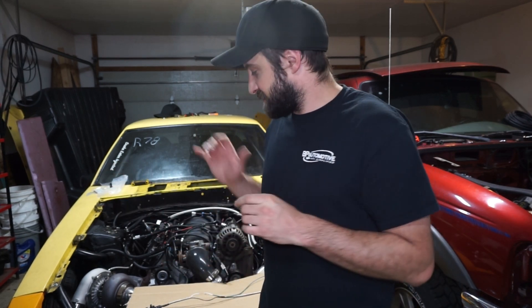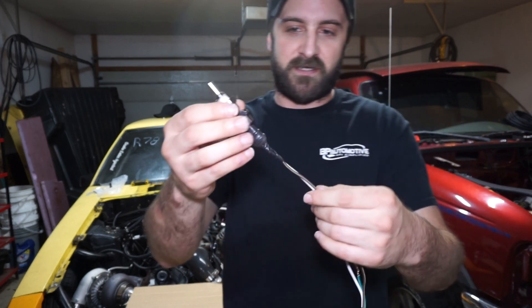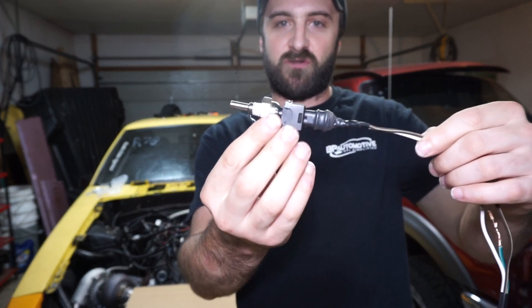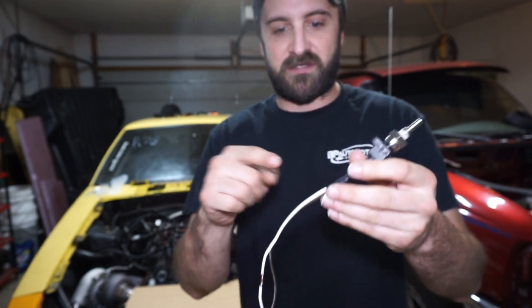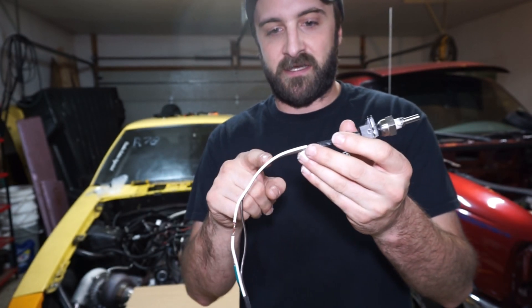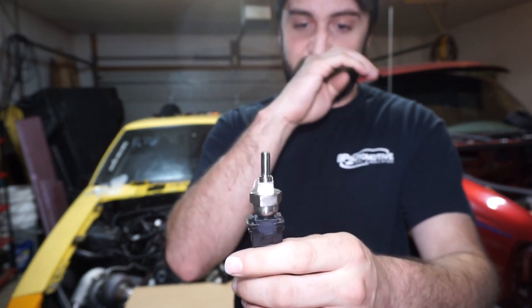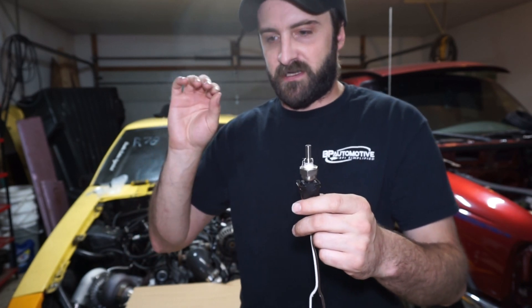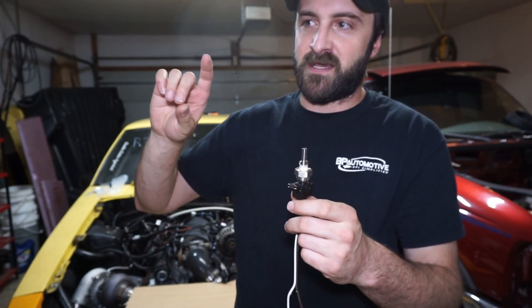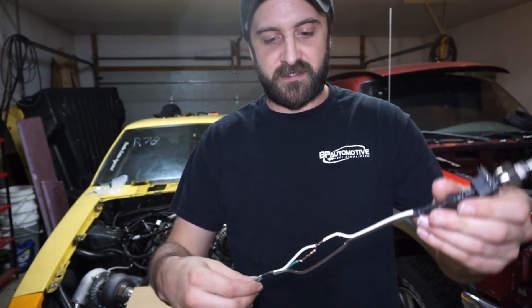What I'm going to do today is modify a regular two-wire harness. This is just a regular two-wire temperature sensor — it has your five volt and your ground, and it uses resistance through the circuit to give a resistance reading back to the computer. There's basically a five volt pull-up circuit inside the computer, and what I want to try to do is replicate that in the harness.